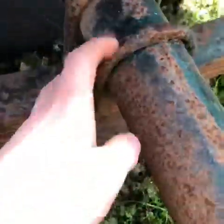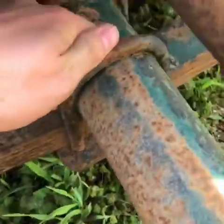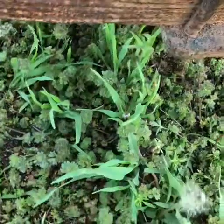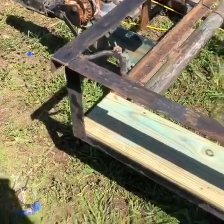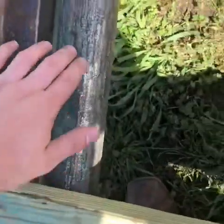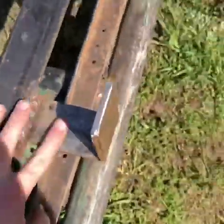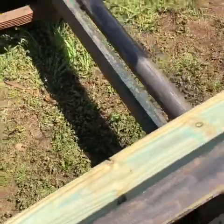The U-bolts are just fine — no deep rust, just a tiny bit of surface rust. I've spent pretty much all morning on this thing. I've done a lot of grinding all over the frame, up and down the whole thing to get as much rust off as I can. There's still a lot on there, but most of it came off.